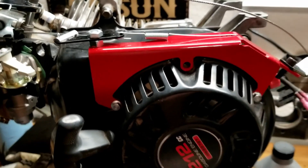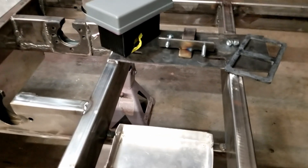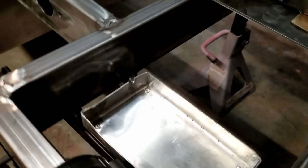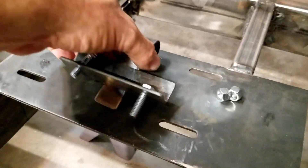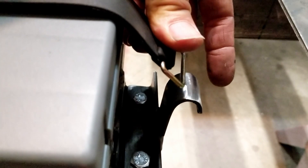I solved my battery mounting dilemma. It's going to go behind the axle, next to the motor, underneath the frame rails. I put some three-quarter by three-quarter tubing and riveted my tray to it, then bent a little piece of one-inch angle iron to hold a rubber piece. The battery rubber sits in here and then the battery drops in. I made a strap bracket, and over here there's a piece of angle iron welded to the side of the frame with holes to take the bolts.